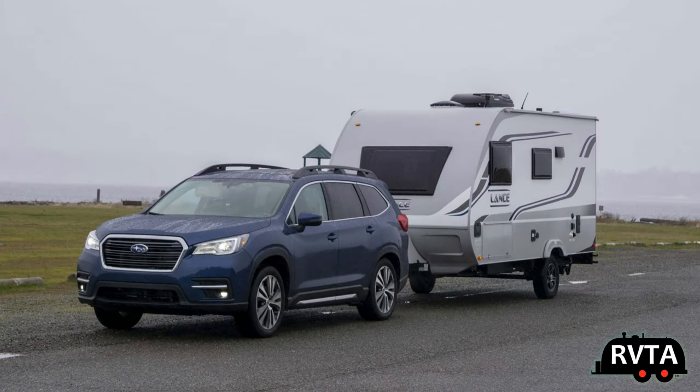Upgrade from there, and more contemporary in design. It used to be all travel trailers were sticks and tin before the advent of the laminated travel trailer. It's called laminate because they laminate a sheet of fiberglass onto a piece of substrate. In the past, it was Luan, a piece of wood, but they had a lot of issues with that. It bubbled up, it absorbed moisture, and because it's wood, it sort of got fat and you'd see all these bubbles. That was called delamination. Not a good thing. But now they've replaced that with Azdel for a lot of manufacturing. Not all, but a lot.